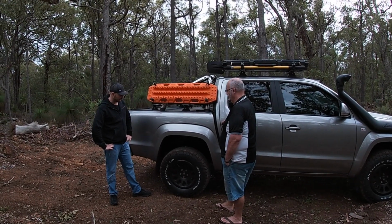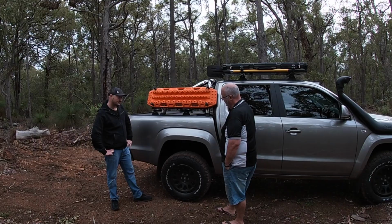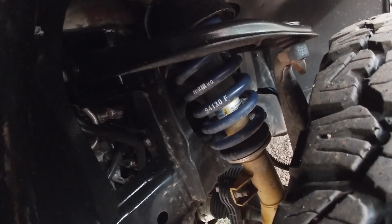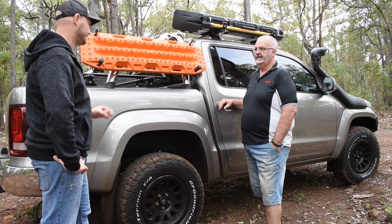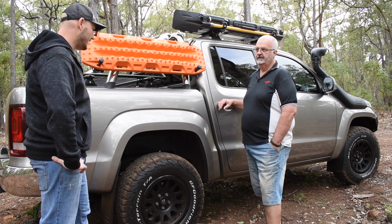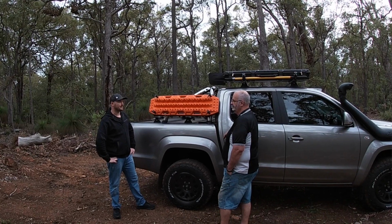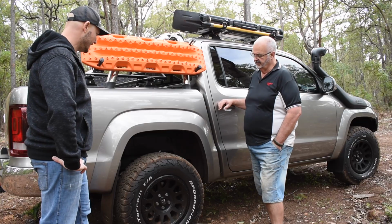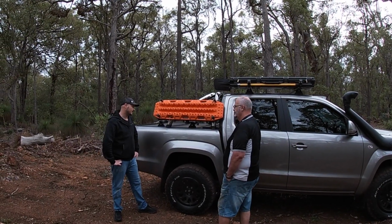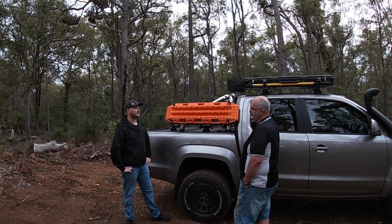The wheels are 17-inch Fuel Vectors, and the suspension is Bilstein shocks all round, and they're a modified Bilstein. So you've got adjustable seat height on the front and a 13mm shaft instead of a 12mm shaft. Marginally bigger shaft, bigger reservoir that goes with it. I think the reservoir is the same, it's just the bigger shaft, and there's a guy, Net 4x4 in Melbourne, who's designed those and pumps them out for the Amarok. So lift is roughly 2 inches, give or take. 20mm blocks in the back, and we ended up with around 40 to 45mm lift in the front, and that's running H&R springs.